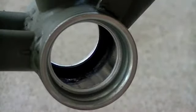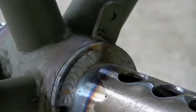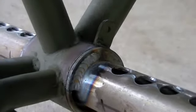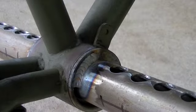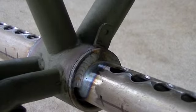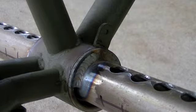We got the race and pretty much everything inside of the bottom bracket cleaned out so there's no grease, and we're ready to weld. I'll get the welder set up, get the foot peg bar positioned in place, and we'll lay some beads. There you can see I got the foot peg bar welded in place. I only welded the top half, and that's way more weld than this is ever going to need — basically all we want to do is keep this bar from rotating and keep it from going side to side. I got the same amount of weld on the other side.